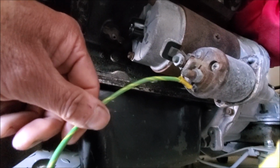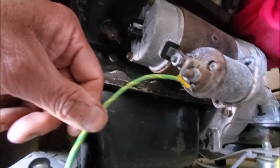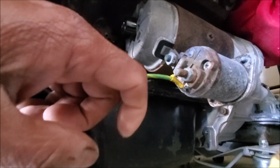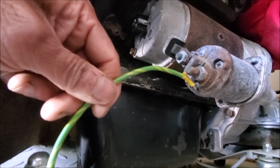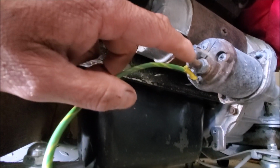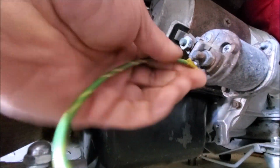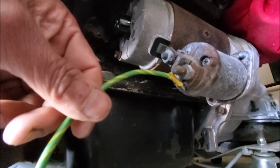So what people do sometimes, and I've done it on my May 71 Stag, is add a relay. Tony Hart added a relay. They're not too difficult to understand how they work, but basically the way most of them work is you're connecting a direct 12 volts. The white and red wire from the ignition goes into the relay, and when the relay is connected, it's making a direct connection from this bolt connection to the solenoid, this little connector block on here. And that's a fix.